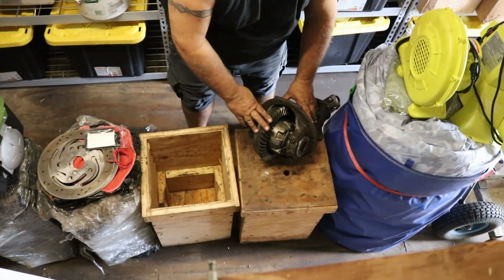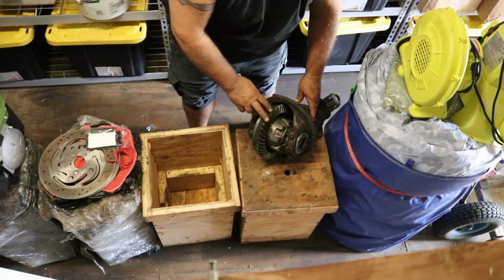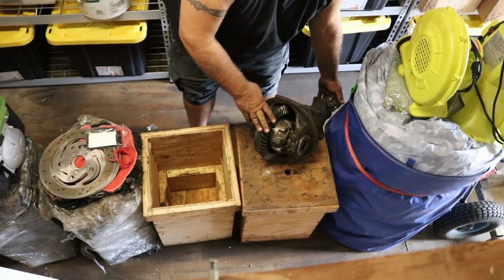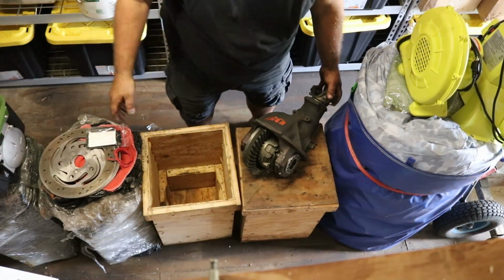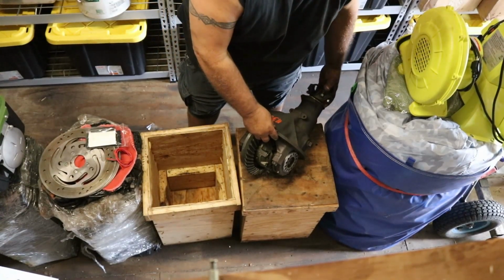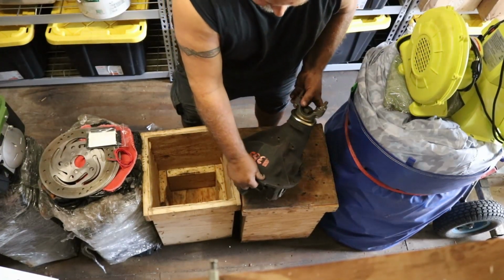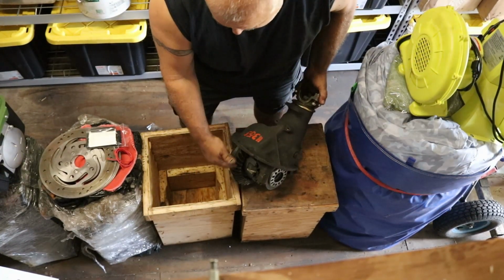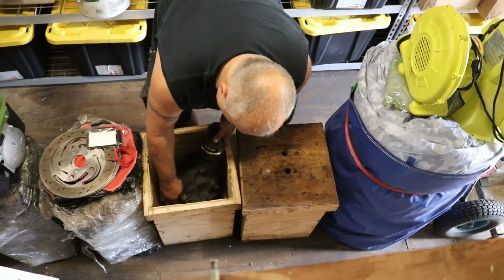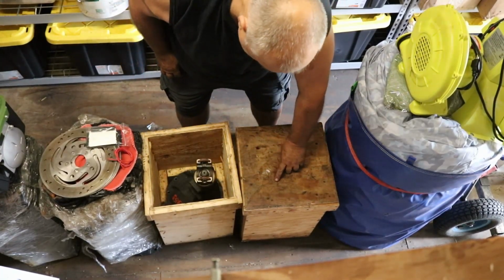355. Yeah, once again, this is my 355 gear, and it's on a locker. It's a good gear, I just don't like the way the locker is working. It used to work really nice, and it's started not unlocking on one axle, and I can't find nothing wrong. I've had it apart 3 or 4 times, but at the drag strip, I don't care if it breaks loose or not, so I'm going to put the 411 on it and take this gear and put on my other one. That's the 411's on. Oh, that's heavy. So first thing, let's get them over there.